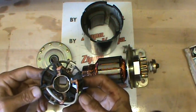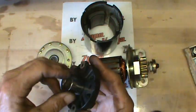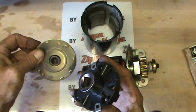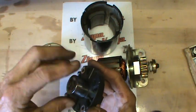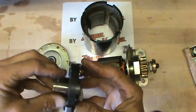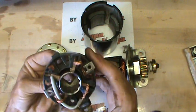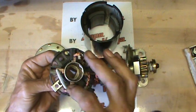There are some brushless out there, but for the starters that have a brush plate like this one, you can see I've got a socket stuck in there. Before I took everything apart, I found a socket that fit in the hole of the brush plate after I removed the tail cap. I pushed that down in as far as I could and then raised the brush plate up so that the brushes fell onto the socket and didn't fall out of their respective spots.